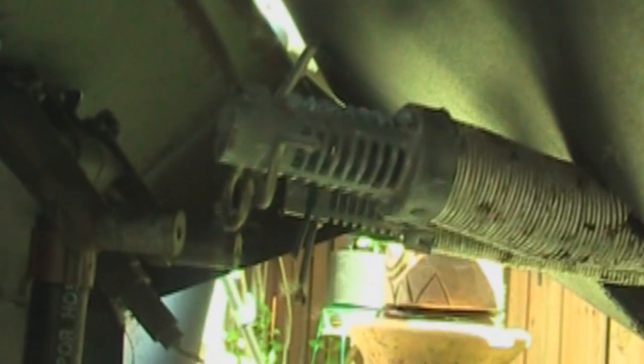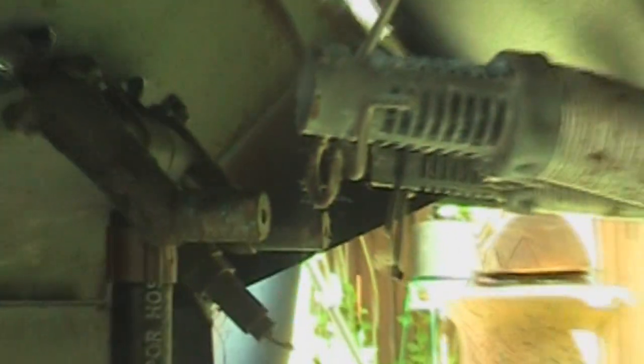Well, as you can see, I got rid of all the grit that was inside of there. Now we're going to move on to the next step, because remember I moved that burner element up, and I could have maybe pulled those hoses out. So we're going to make sure that those are still attached to the adjusters there. And just as I suspected, the hoses got ripped right out of the line. See right there, the hoses? Okay, we're going to reattach these.